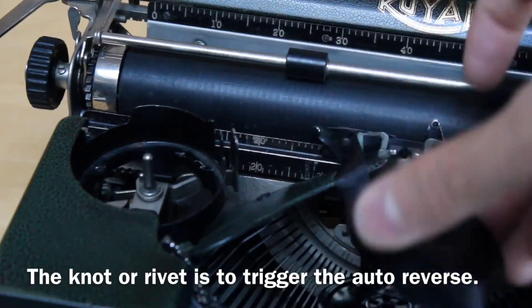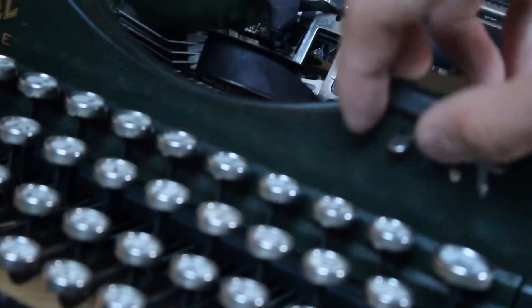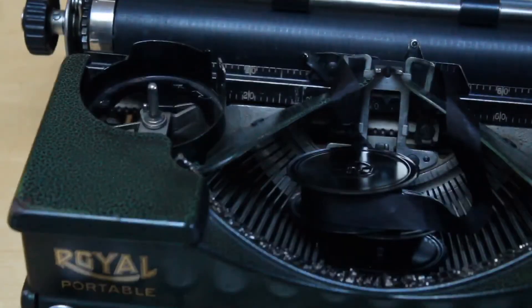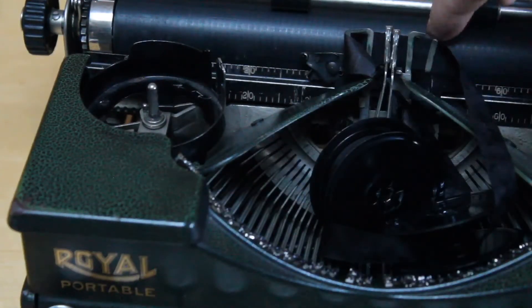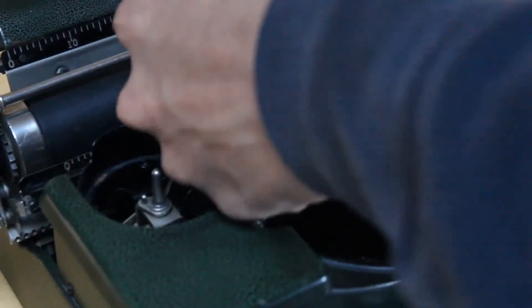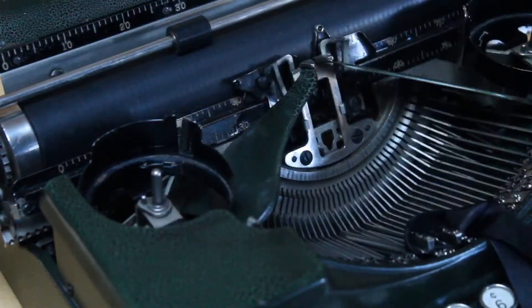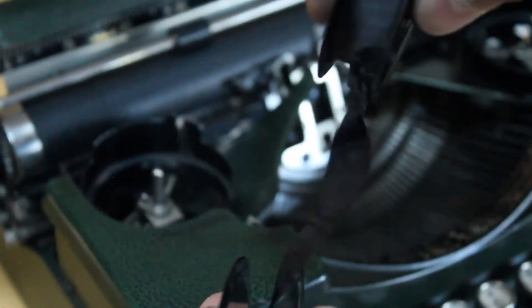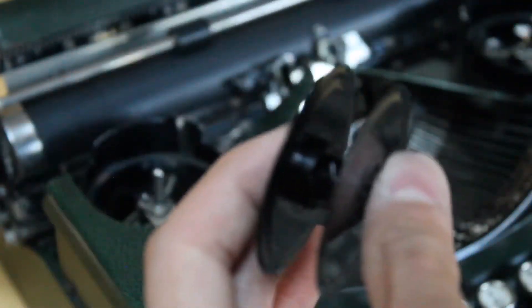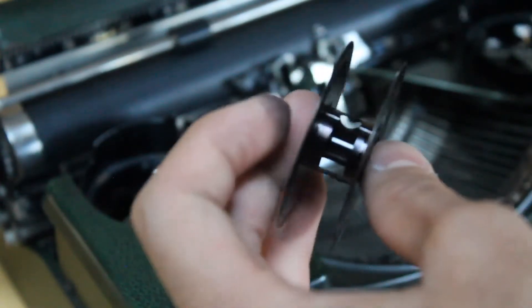This is the one that you wound all the ribbon onto. Flipping to the red setting with the color selector, you are going to want to jam two keys up to raise the ribbon vibrator. Then it is just a matter of untucking the ribbon from the tines and pulling it off the machine. Once you have done that, just wind up the one side that has the ribbon on it and then remove the ribbon from the other spool — it should just come off, as it is only speared on there with a tiny little hook on the inside of the spool post.